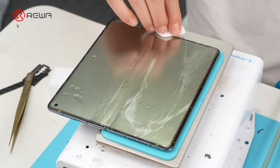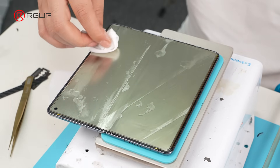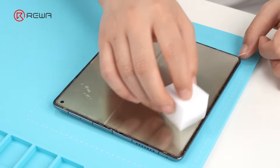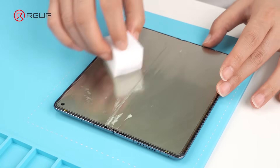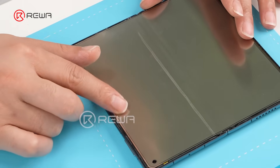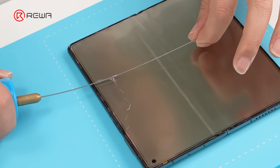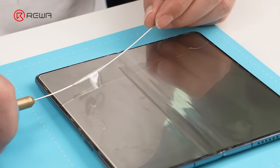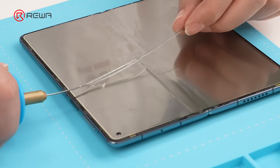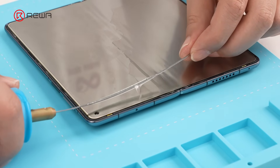Use a special liquid to gently wipe. Attention — this layer is fragile. Heat it again to soften residual adhesive. Now use an electric glue remover to clean the residual glue. Because of the heat, we can lift the glue more easily, but we need to minimize contact between the remover and the display layer. Too much force on the display layer may damage the screen.